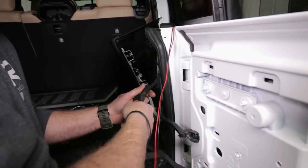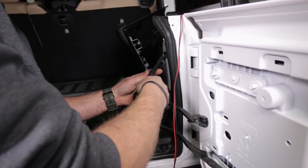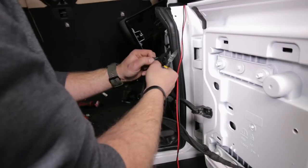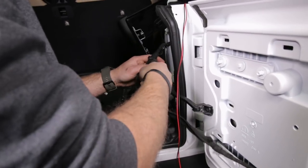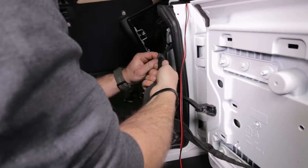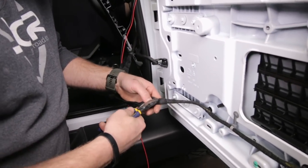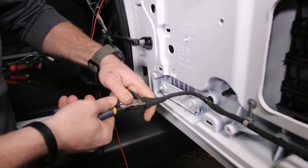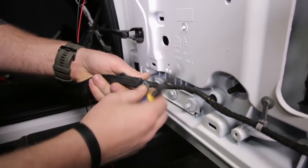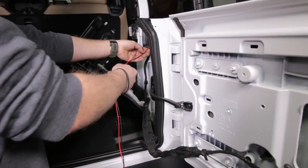Pull off this factory cloth tape using scissors or snips - be sure you don't cut through any of the wires. We'll re-tape it with regular electrical tape; we just want to get into this nylon loom. On both sides, we'll do the same. Now we're going to follow this loom with our new red and black wire.